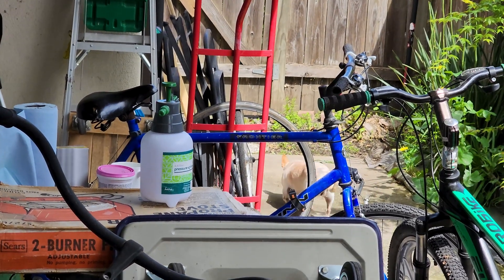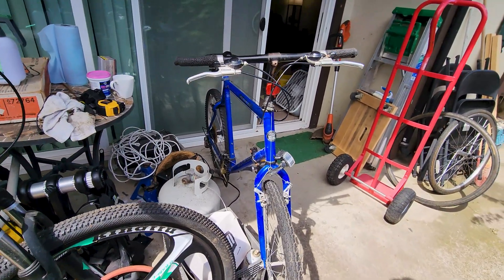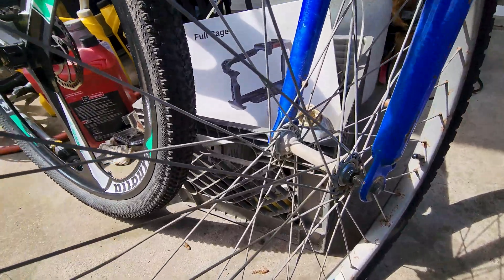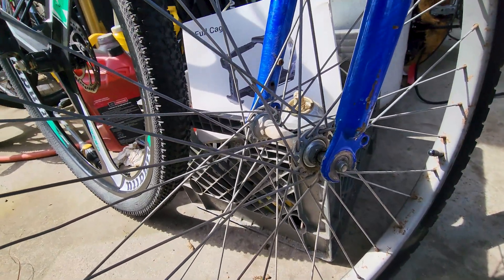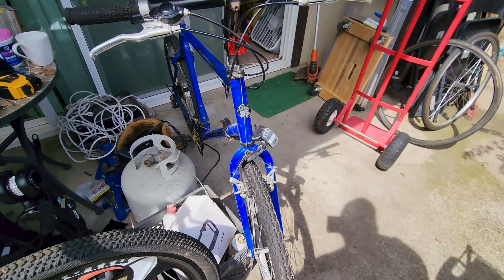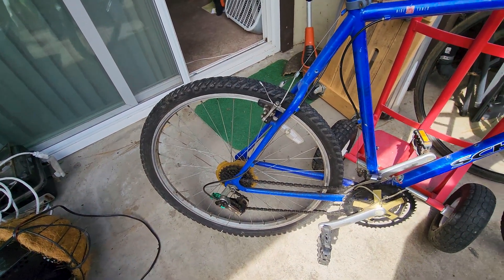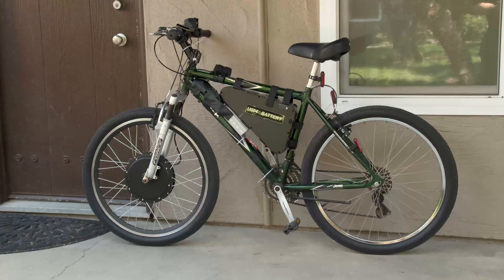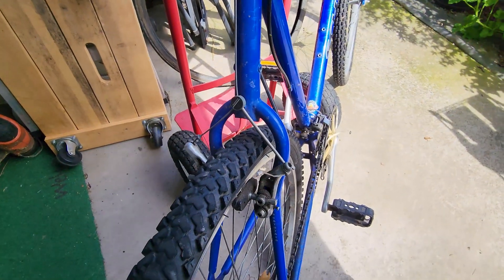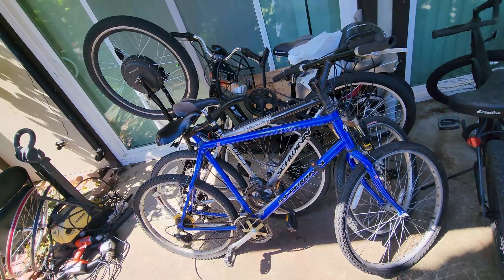Is that a tall Schwinn mountain bike? It is, and it's not the worst basket case bike I've ever seen. It has brakes, which is more than I can say about the cruiser. It does have these weak standoffs on the forks, and that has me worried because I've run into issues with standoffs before when I tried to upgrade the cruiser forks. It also has 90s-style cantilever brakes, a ton of rust, and a broken seat. But it is a lot taller than the last mountain bike build, which was too short — and at 6'5", that made it dangerous. So I think it's worth it to give this thing a try. Now it's time to make room to start the blue bike e-bike build, and then we'll start the next day.